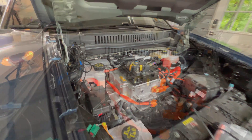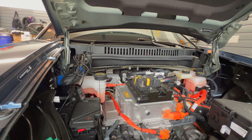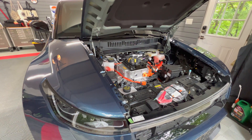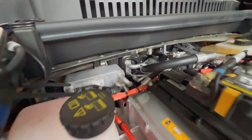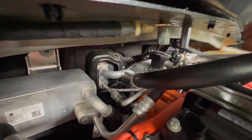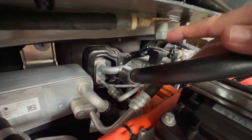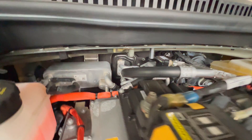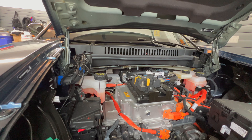The vehicle may then suddenly, or at odd times when it goes into park — especially if there's a bad connection between the PKC module and the BLE key fob — go out of ready mode when parking. When the vehicle is boosted back to life and potentially moved, the connection could have been restored again, especially since the ground nut and the negative terminal for the boosting stud are right next to each other. So check to make sure this nut is tightened properly. Thanks again to Christian Batchel from the FOA Facebook group for this tip — I definitely recommend opening your hood and checking this grounding bolt.